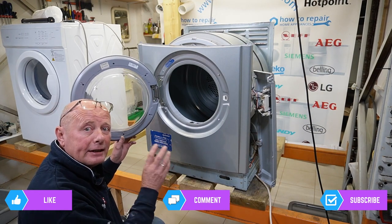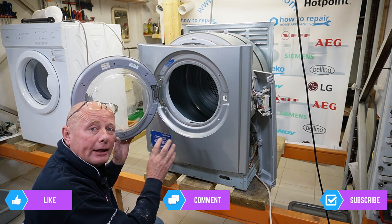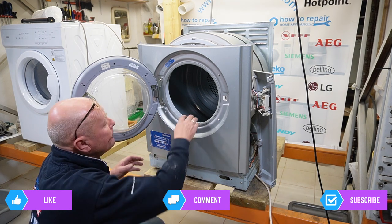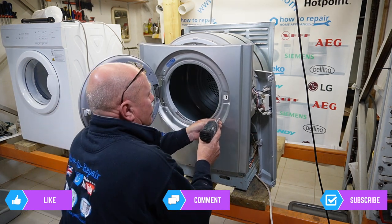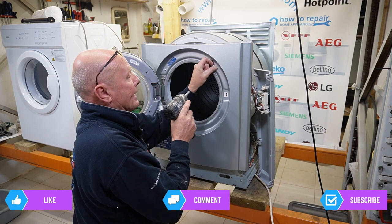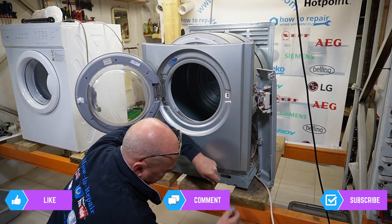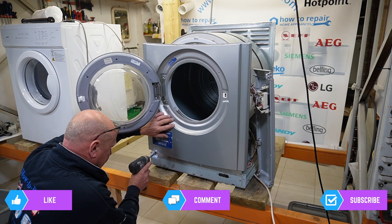It's not only what you can see. You need to work out the ducting system and actually clean this up. The plastic surfaces of the ducting system really want to be as sparkly as possible — clean as possible — because the less friction it has, the less likely it is to stick to all the pipes. So we'll take the filter out first, and then we'll undo the screws inside the door here. You may need help supporting the actual panel, but there are some supports on the sides, which was a modification by the Hotpoint and Indesit company years ago.